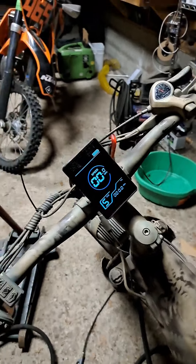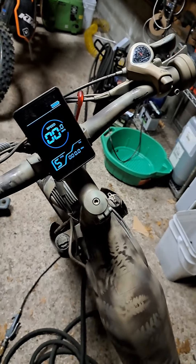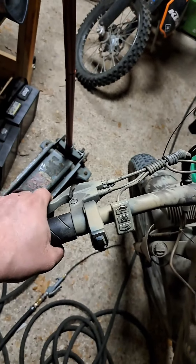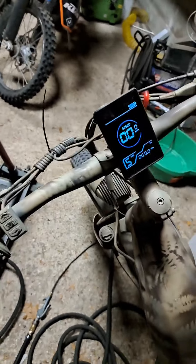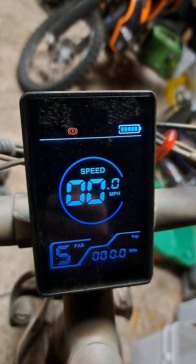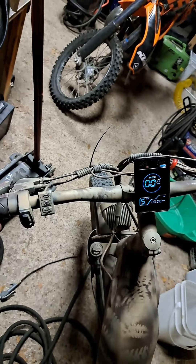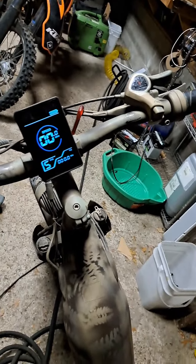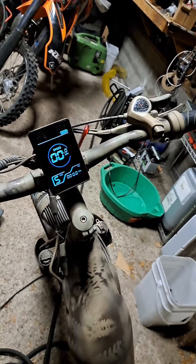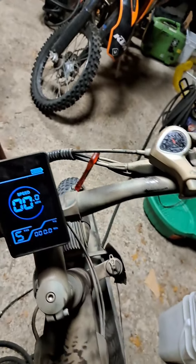Amyet support says that's normal. Fortunately, when you do pull the brakes — both brake levers have a sensor connected to them — they know when you're pulling the brake, and you can see that on the display. That cuts the motor out, but you've got to be ready to pull the brake, because you'll be driving — whether pedaling or throttling — and all of a sudden it'll just keep going.